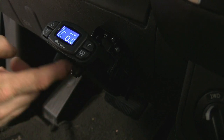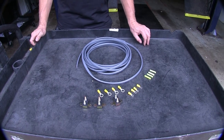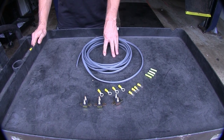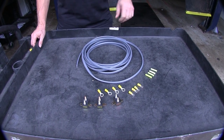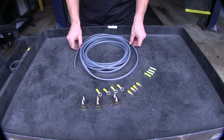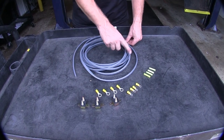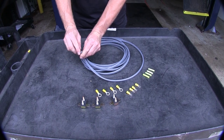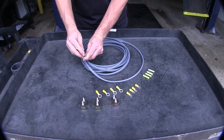Next, we'll go ahead and show you how we installed this brake controller. We'll start with part number 5506 first, our wiring kit. We'll work with this, and then work up to our brake controller. Let's go ahead and cover the parts that come with that. We've got 25 feet of cable right here, which is 10-gauge material with two wires inside the sheath.